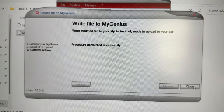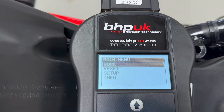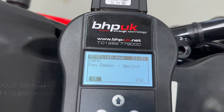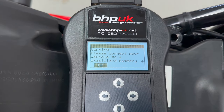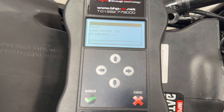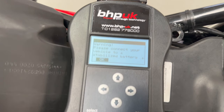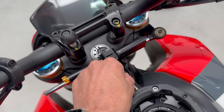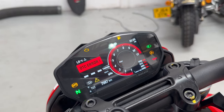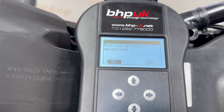Close it and job done. Plugged it in on the bike, nice and easy. Three lights on the battery. Go to Work — Writing. There you go, it's picked up the mod file. It actually says Van Demon and Sprint. Click OK. Please connect your vehicle to stabilize battery — yes, done that. Switch on the dash, click OK. Operation in progress — switch off the dashboard to continue. Connect your vehicle to stabilize battery, switch on the dashboard again. Look at that — the dash has gone bananas, so it's definitely doing something. It's just sending this mod file.